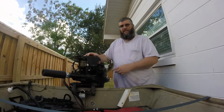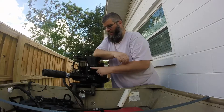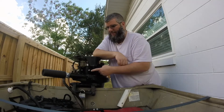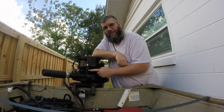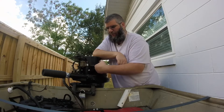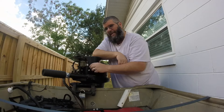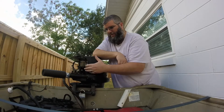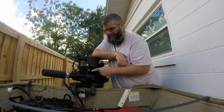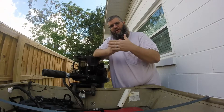The starter is non-OEM — it's an aftermarket, Chinese-made knock-off. It was about 40 to 45 dollars on Amazon. I used M8 by 50mm screws. It holds it snugly up to the housing where it's supposed to mount. The problem is with it not being an OEM starter — the starter sat too close to the flywheel, so I needed to shim it out. I used one washer on the outside and two washers on the inside to give it a little off-center, not a straight flush connection, but a little bit off.